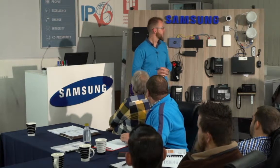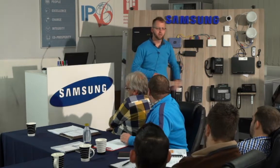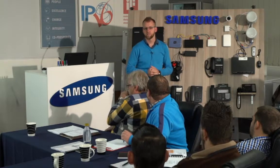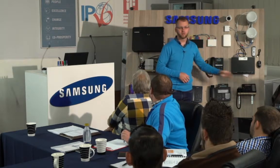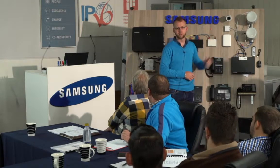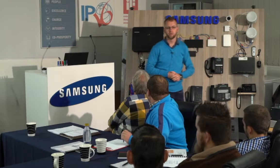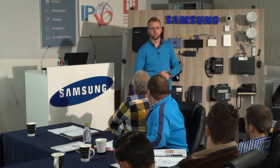Keep in mind, all your devices, your PABX, your audio codes, your IP phones, they all have a session timer that connects back to the PABX. By default, those timers are 5 minutes, so 300 seconds. So if this link goes down, and this phone started on 1 minute, then for another 4 minutes this phone won't connect to the hosted solution. If the client needs an urgent phone call, they can reboot the phone, send a new request, and the new request will go out on the new link. Otherwise, just wait an additional 4 minutes, and the phone will re-register on the new APN.